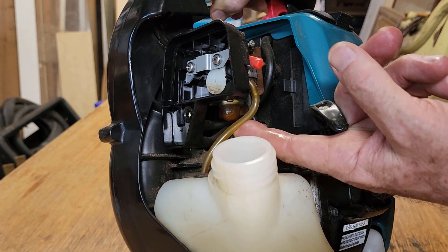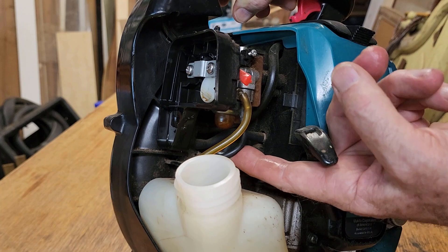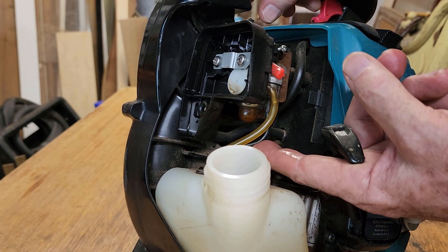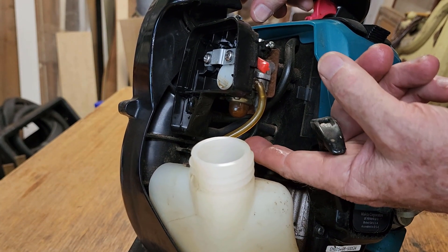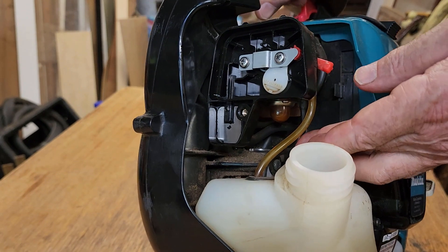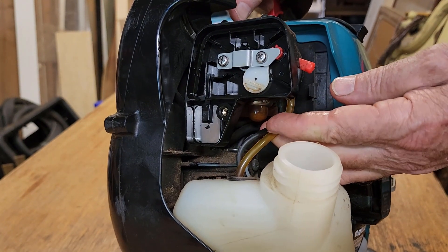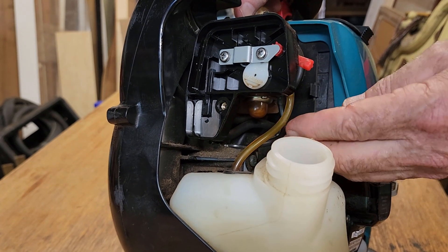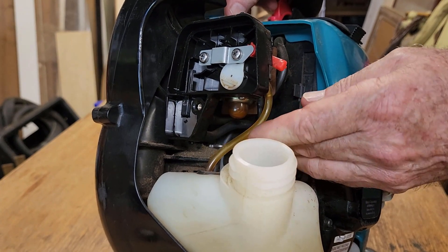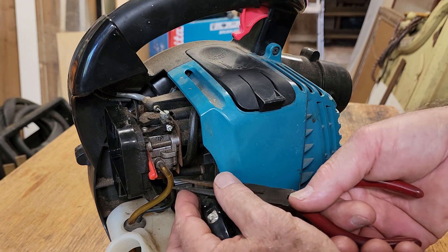The return line is clear so that you can see the fuel going back through to the tank, and the black hose is the main pickup hose which will have a filter on the end of it in the tank. We might blow a bit of compressed air back through that just to clean the filter out. They can also break down with age — especially if you store it in your shed and the sun shines on them, the UV rays will actually damage the rubber.